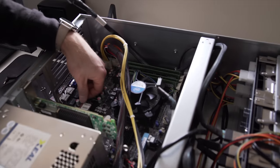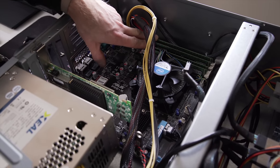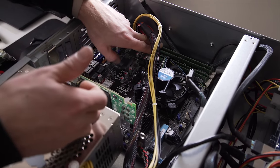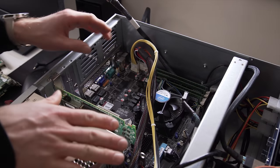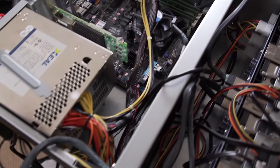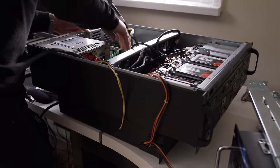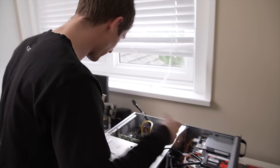I'm enabling faster than one gigabit transfers between all the rack-mounted computers using single cables between them — not going through the router or switch at all. I changed out the motherboard to one that has remote management, adding a little iKVM module. I've changed out to ECC memory — not strictly necessary with Unraid, but I want maximum stability. I'm running VMs so I can have my Air Video server on Windows and CrashPlan in a Docker container. I'm running a Xeon processor to take advantage of that ECC RAM, and it uses a 12-bay versus 8-bay case since at home I don't have those same high-capacity drives.